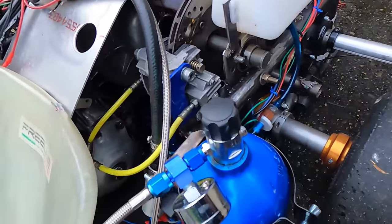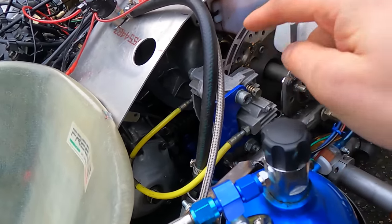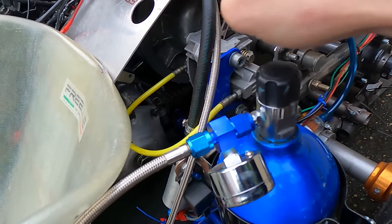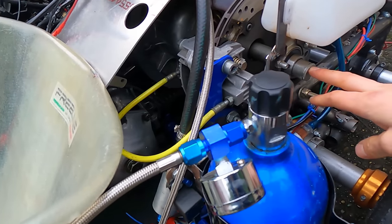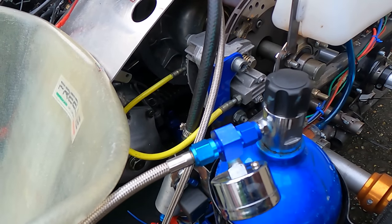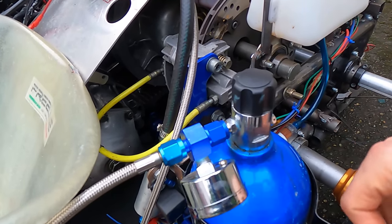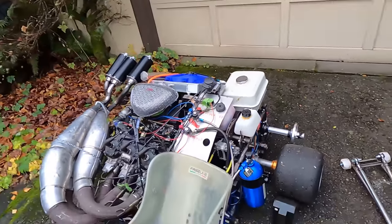It should go about 130 mph with the current gearing ratio. However, you're going to want to mess with the CVT — it's not getting a full shift out. It's kind of hard because it's a Polaris primary and Yamaha secondary, and getting to the actual CVT is a pain. You've got to punch out the jack shaft and remove a couple of things. It's tuned pretty well right now — I've gone in the low one hundreds and I'm happy with that. You probably could get better top speed and acceleration if you mess around with that, but if you're good at tuning CVTs, it does get a little complicated.